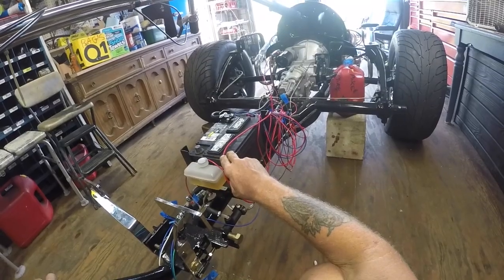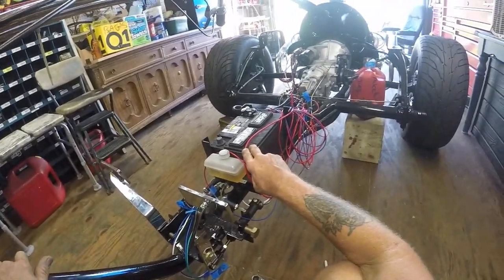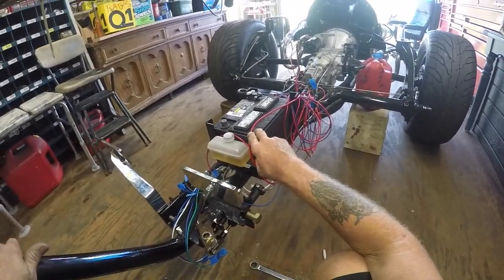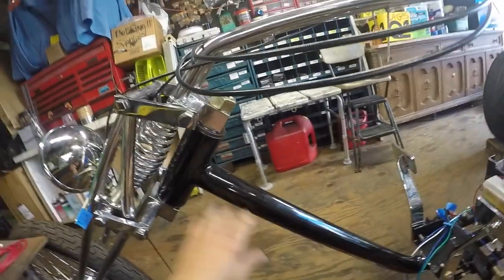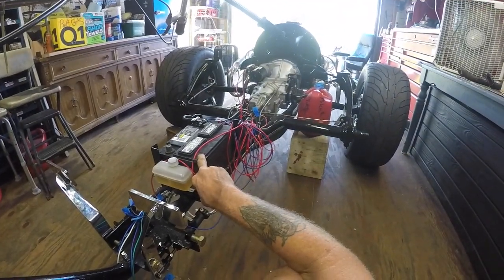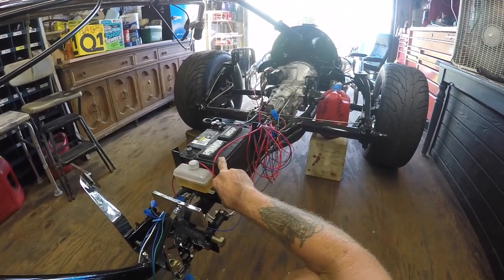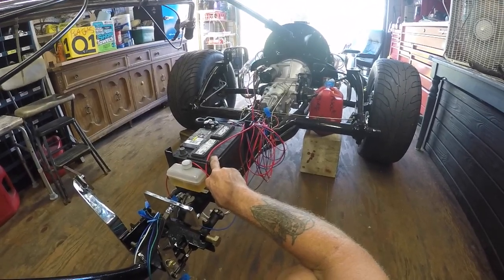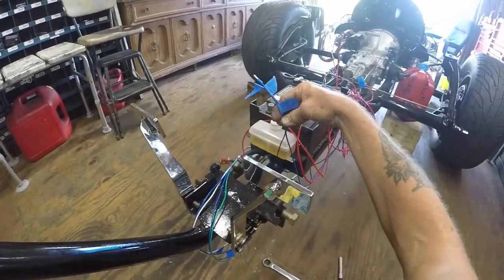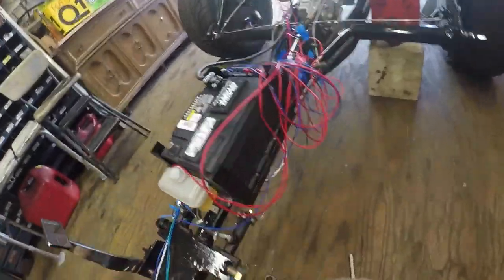I need to order a five-prong light switch so I can have high, low, and park — high beam and low beam. You just turn it on in different stages: park lights, low beam, or high beam. He's going to locate the turn signals to the front. The body has a Torino and a Maverick; they're going to get some sequential tail lights, which have six or seven different LED functions. I've labeled everything — horn, front headlights — it's all laid out so I could roll it around.